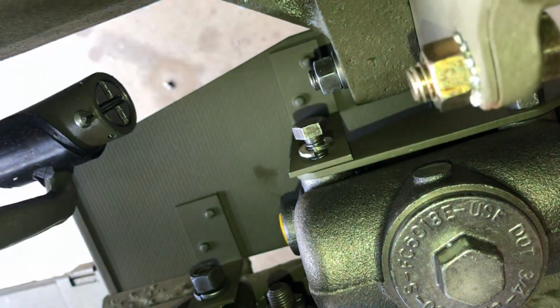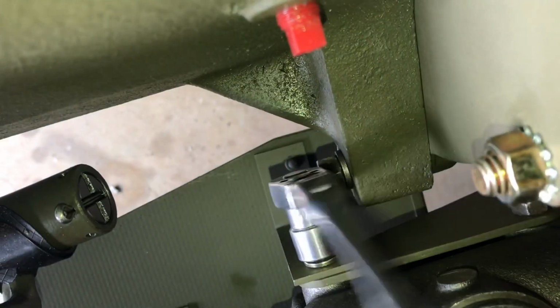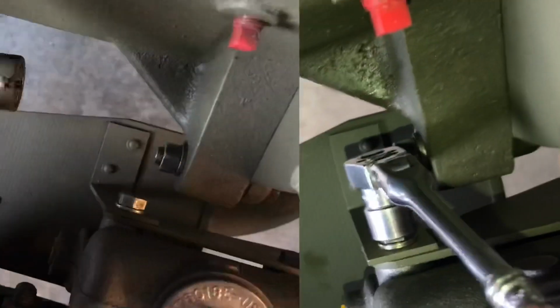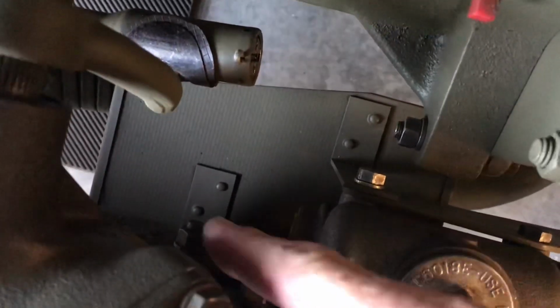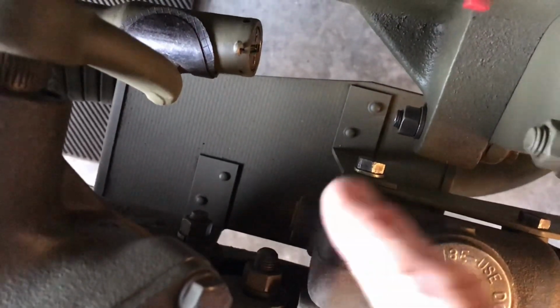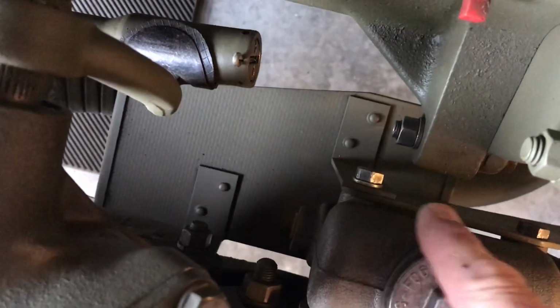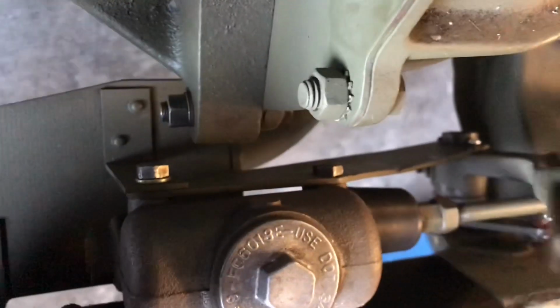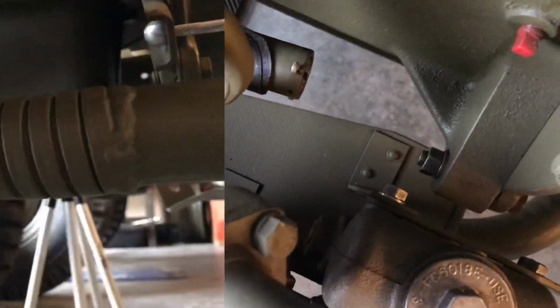In the first part of this video you saw, there was no master cylinder installed at the time. While I'm tightening this down, I can explain that to you a little bit. All these pieces are tied together in the end. The bolt I'm pointing to here actually is holding on the steering box, and this bolt is also holding on the tie bar that connects to the pedal shaft that holds on the pedals towards the back side of the assembly. The system is actually ingenious because it uses very few fasteners to hold very many components together.